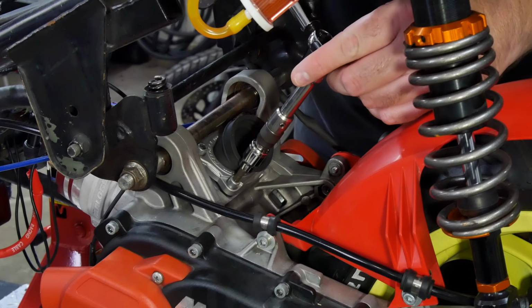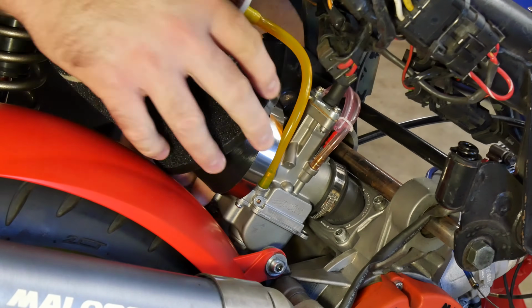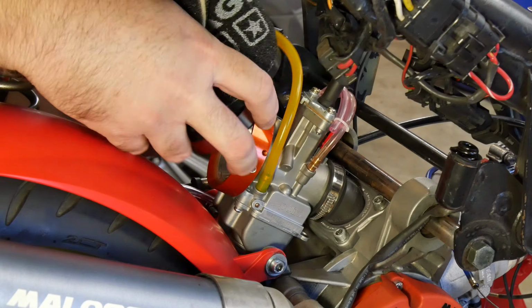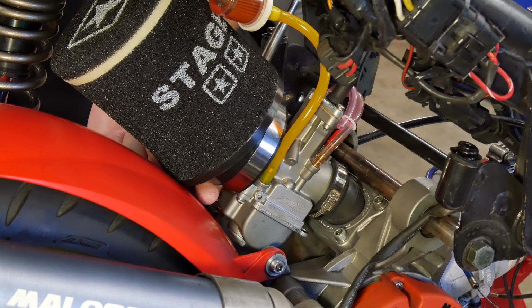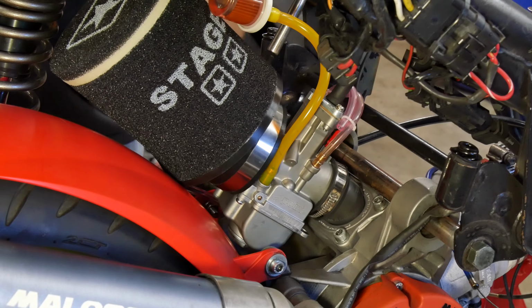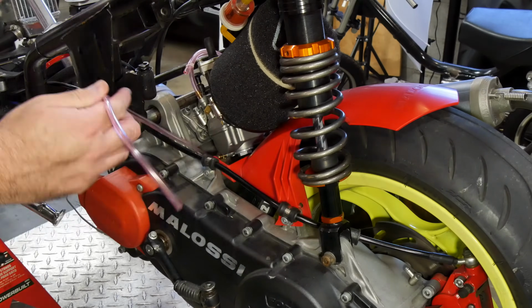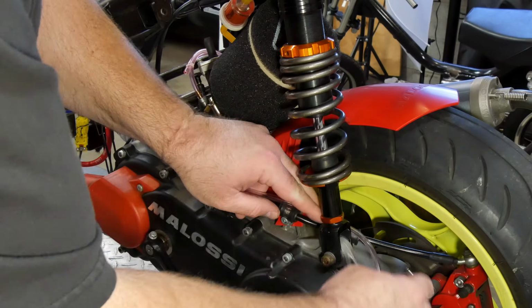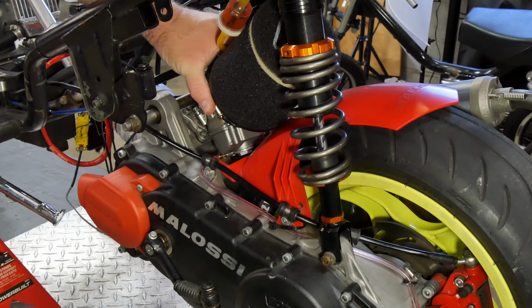I torqued the intake and installed the carb and filter properly with clamps. The filter does rest on the fender, but I'm thinking that may actually be a good thing. I had to make a bracket to support the VHST with the 360 intake to keep it from drooping or bouncing, but the filter may actually provide a little bit of support this way. The fuel line was pushed on, and then I secured the overflow hose so it would be toward the rear and aimed outward away from the tire.